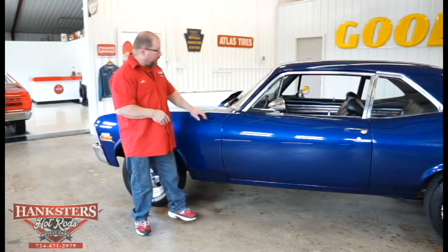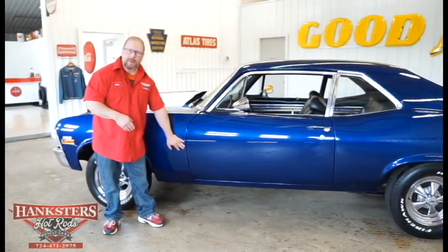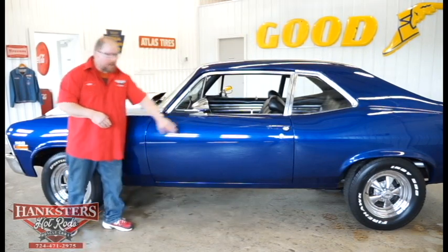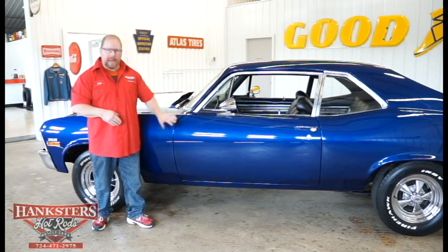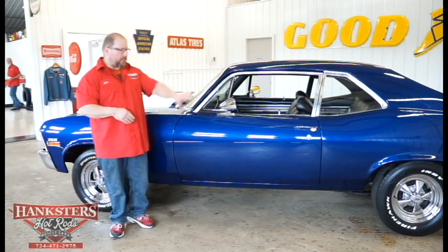As we walk back, we'll stop at the door at the front and take a look at our gaps — the front gap as well as the gap on the back side of the door. You can see those gaps are very uniform front to rear. You can tell that door's been adjusted really nice front to back, as well as in and out, with those elevations lining up with the fenders and the quarter panels.